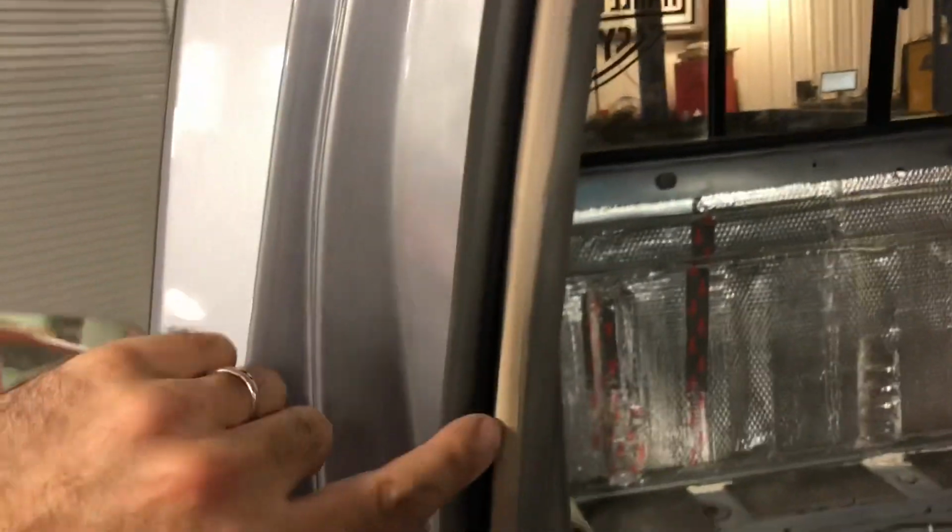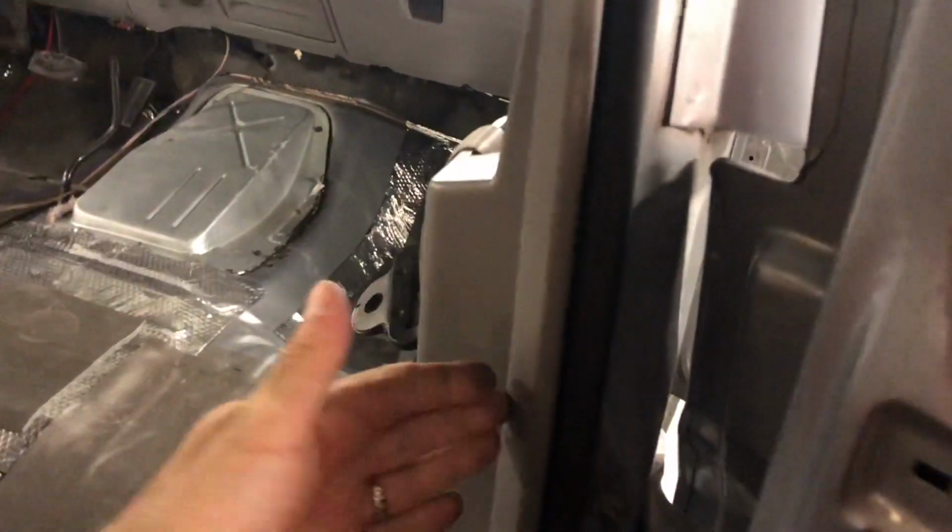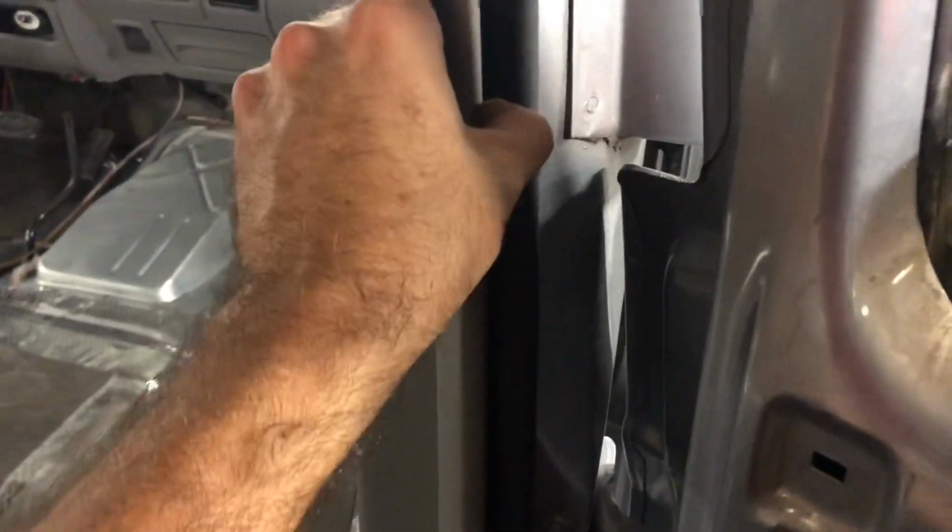So when you get your seatbelt fed through the hole, what you're gonna do is see how that kind of locks right in that channel of the weather seal. So you're gonna lock in one side, push it up. You know, it also holds up your headliner right here, and then come around to the other side. And you've kind of got to bend it back so it pulls this little seal out and then tap it in there. So it also holds your door seal in, like I said, and then the bolt will line right up for the seat belt. So, all right, guys, keep cranking.